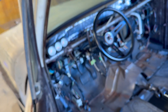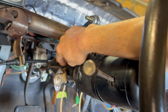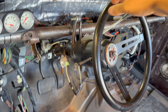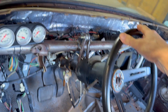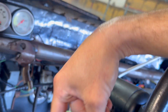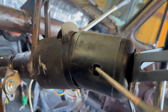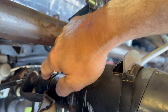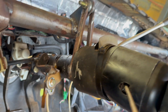The column is sturdy and it's mounted. Remember when I took the column apart? There was a bushing bearing I had to actually cut off the shaft, and there's nothing in there now. So the whole Bronco steering shaft only has the bearing in the front end on top. I think that's where the play is in this steering wheel, because it's all in the Bronco side of it. The Crown Vic stuff down there isn't really the issue - the play is there and this shaft's only this long now with no bushing or bearing. I'm going to try to get the right bearing set up - the factory Ford part. I may even just run up to the hardware store and see if I can get a bushing that'll fit it.